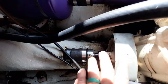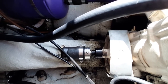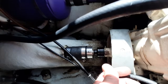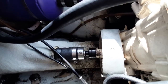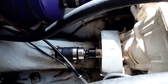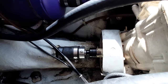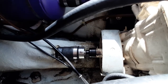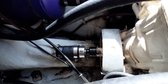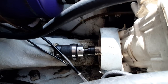Do not just take the cover off completely, because if you ever do get water in the engine bay — even if it's not very deep — the PTO under this cover will sling it right up into your air box. Ask me how I know. So just cut it back to where it still covers the PTO and you should be fine. Just make sure to grease it. It's a really good mod. Anything Speedster-wise, if you think of any videos you want me to make, just drop a line in the comments. I've had this boat for a long time and I pretty much know everything about it. See you next time.